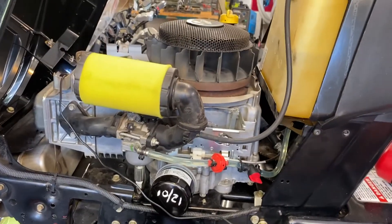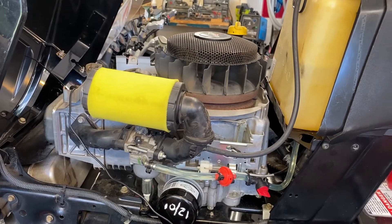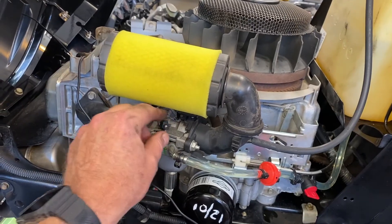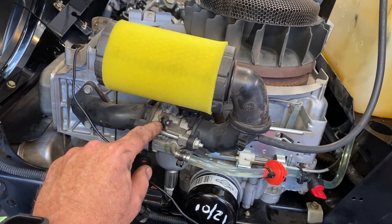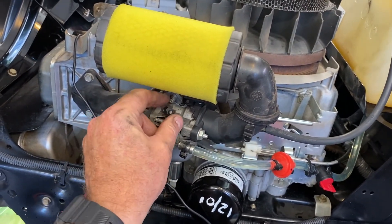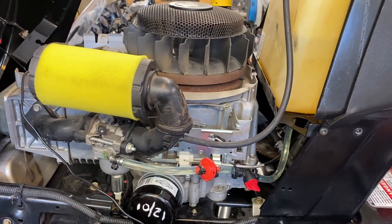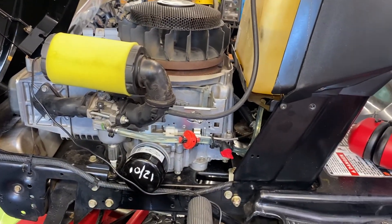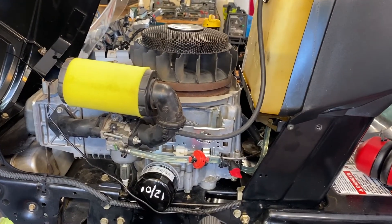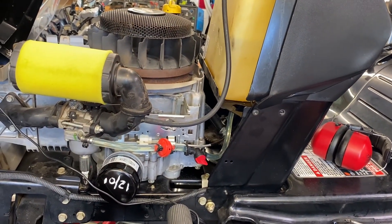3380 — I'm happy with that. Sounds better, sounds where it's supposed to be. I'm not going to go any further than that. The idle goes up a little bit in this setup because of the way the fuel screw is adjusted — this is the low or idle pilot screw, and it's got this EPA plug on it so you really have to break it off to adjust it. I brought it in and it's about right — 2000 RPM at idle is fine. I'm more concerned about wide open throttle, the high speed, because I want this thing to cut properly and not crawl around like grandma's 1975 Buick.